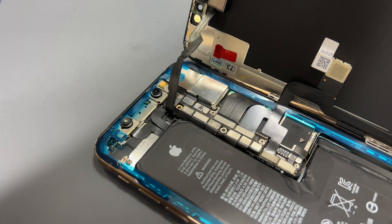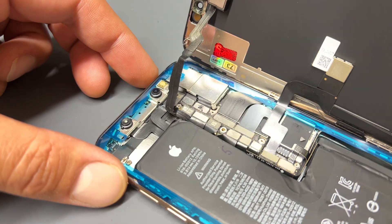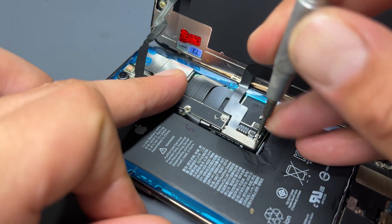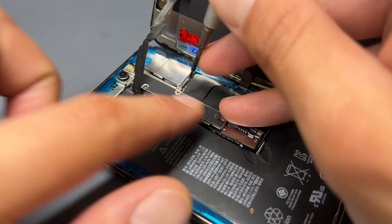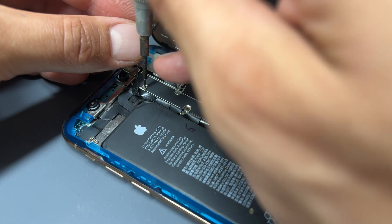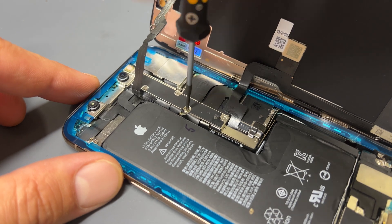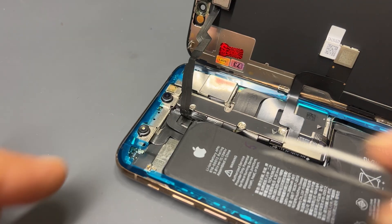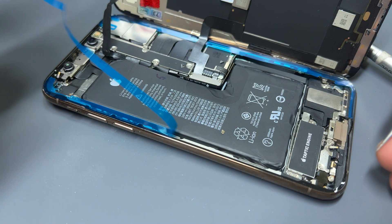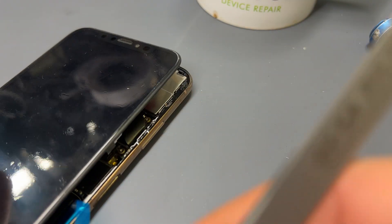I'm not happy about leaving a single screw missing — looking at it, I think it needs a standoff screw. We'll get the standoff screw in the board first, then the shield on top of that, and then go for the screws in the bottom, install another tri-wing screw in that top position, and finally a cross-head screw in the middle. There's a final blue film to lift up on the dust and moisture resistant seal — carefully peel that back all the way around. If it peels off a little bit, just rub it back into place with your spudger and then try to peel it back again.